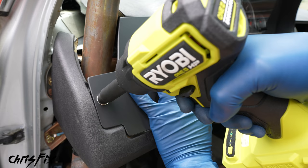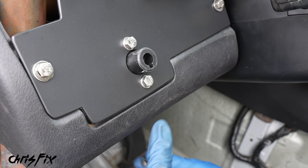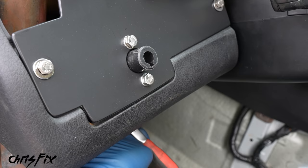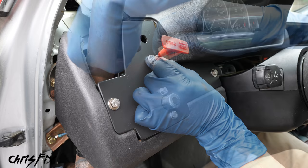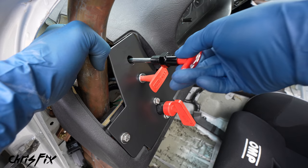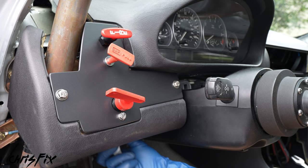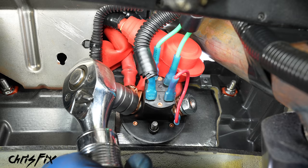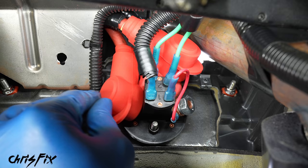First let's get the mounting bolts in — I'm screwing this in slowly so I don't damage any threads. Then we can get the other mounting bolt in as well. Now we can get the kill switch in place and push both bolts into the switch to hold it in. The nuts I'm using have a lock washer built in, which makes this quick and easy — just hand tighten the nut onto the bolt and then tighten it down the rest of the way until it's snug. Same for the top one — make sure you don't over-tighten it because this is plastic and you could crack it. Finally, let's get our fire suppression switches in — carefully feed the switch all the way in, hand tighten the nut on the back, and do the same with the other fire suppression switch. Snug the nut up with a wrench so it won't budge, and do the same for the bottom one as well. Now the last thing to do is tighten down the two main nuts on the back of the switch all the way so they make good electrical contact and won't come loose. The cables are thick and stiff so I waited until the end to do this — it makes it a lot easier to move the switch around when you're trying to install it.